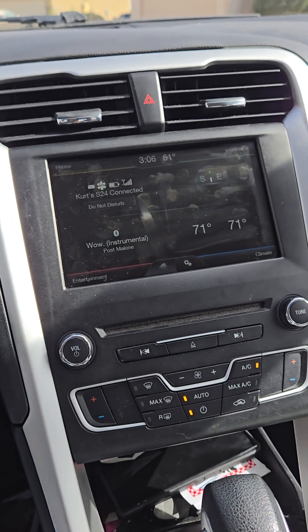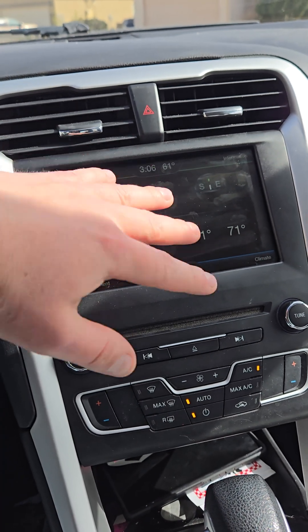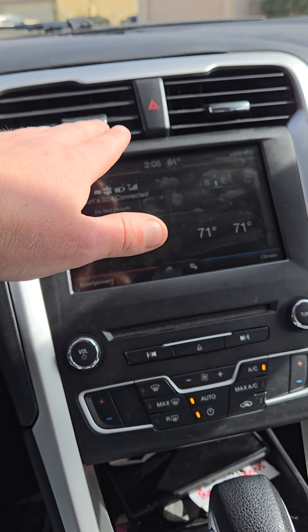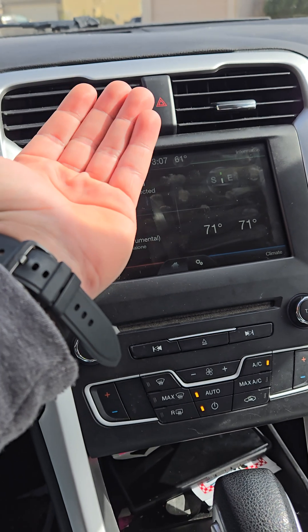Make sure the touchscreen cable — it's a little yellow cable — make sure the pins are oriented correctly, because if they're upside down your touchscreen won't work. The cable has pads; usually the pads go down, but on this one the cable pads go up. There's also a bridge connector involved.